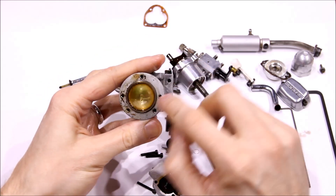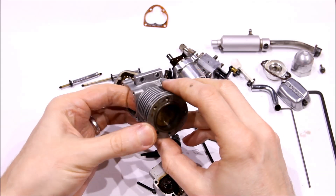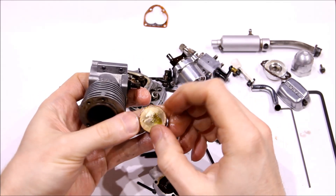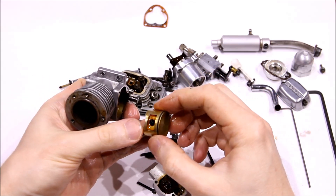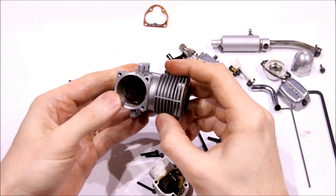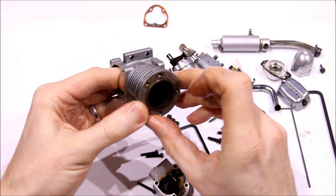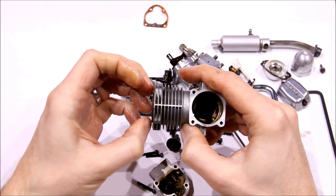The piston has some dirt, and somebody's been in it before — it's marked toward the front of the engine. We'll just push the piston out the top of the cylinder. It doesn't look too bad. The buildup is hard — it was probably run on caster fuel. We'll use the mark to line the piston up when we put it back in, and we'll also mark the rod before we separate the two. There are circlips in the piston to hold the wrist pin in. The gear drive shaft can be very difficult to get out — it's often rusted. You'll have to press it out. The sleeve should come out relatively easily; if it doesn't slip out, some heat will get it out.